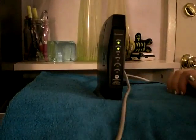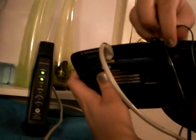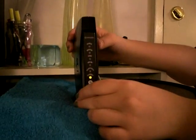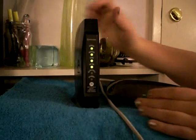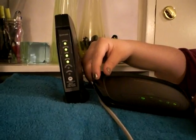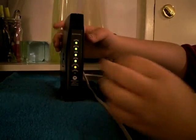There we go — it's starting to boot up. Take the other power cable that goes to the wireless router and stick that into the back. Very important: DC. There's only one hole that it can fit in. And look — it's got power, so the lights are going to start powering on. Most important is first the modem, because that's where the internet comes from the wall into your house. This starts cycling, and then we press the on button — now we have this one starting. These will be different depending on your modem. Basically you just want them all to go green and start flashing.